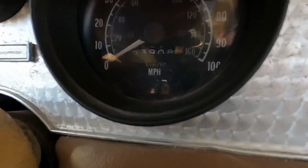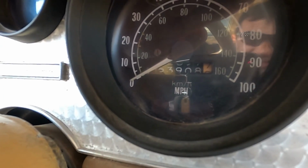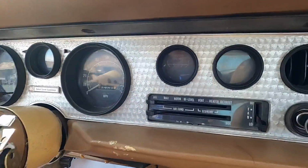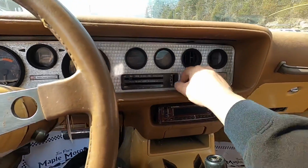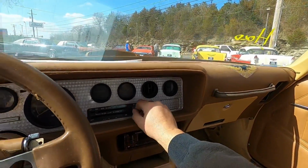Show you the mileage. Hard to stand behind, but very well could be, since this is the original motor. It's showing 23,000. I'd say at least 123,000. The voltmeter is coming up. Gas gauge, we do have gas. I was told that they got about $30 worth of gas in this. The needle is broken. AC compressor's not kicking on. Blower motor is. It's working.